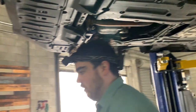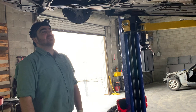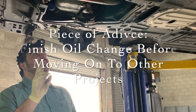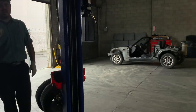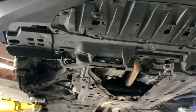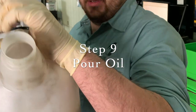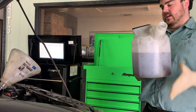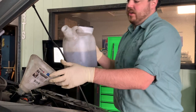A good piece of advice: even though we're doing more services, finish the oil change right now. I don't want to get started on anything else without putting oil in the engine. Doing too many things at once is how things get forgotten. Now we have our oil ready to put in. My best advice is to have the dipstick in when filling — some cars will shoot oil out of the dipstick tube if you fill with it out. So make it a rule: leave the dipstick in when you fill the oil.